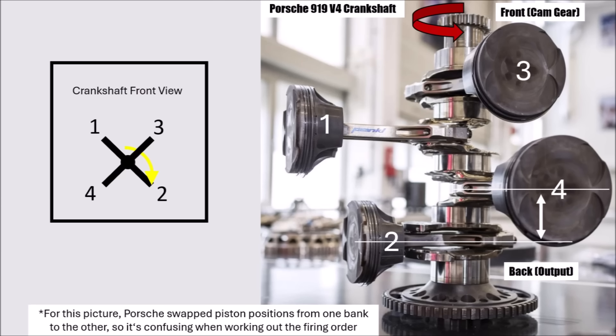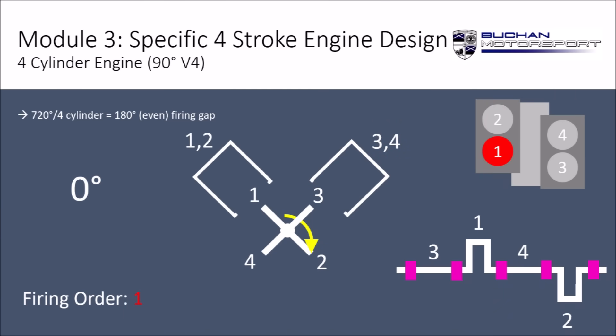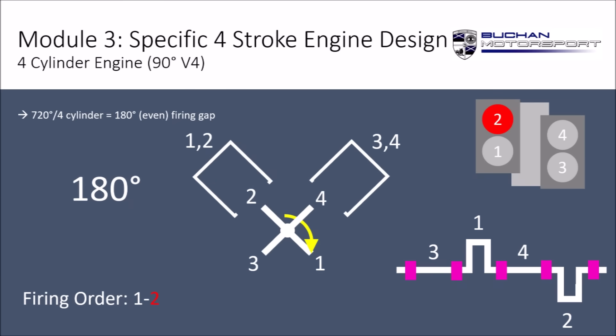We can clearly see how, for a clockwise rotation if you look from the front, after cylinder 1, following the crankshaft gives us 4, 2, and 3. If we now put that in our simplified graphic, we see a crossplane crankshaft where cranks are positioned in a clockwise rotation with 1, 4, 2, 3. With this crankshaft we can now work out the firing order. We start with cylinder 1, and 180 degrees later we could ignite either cylinder 2 or 4. We decide for cylinder 2, and again 180 degrees later we can only ignite cylinder 3, because cylinder 1 just fired 360 degrees ago. And the last one, 180 degrees later, is cylinder 4. So the firing order is 1, 2, 3, 4 — they fire both cylinders on one bank first, and then both cylinders on the other bank.